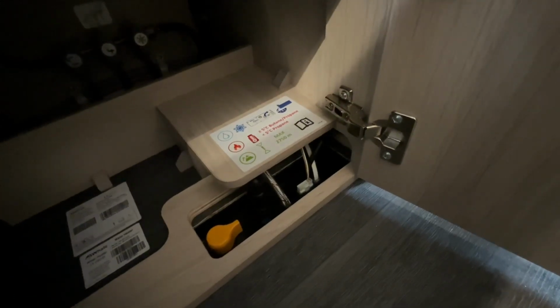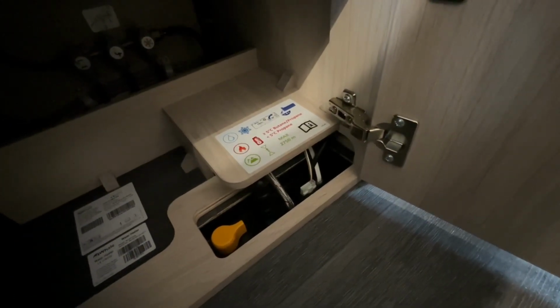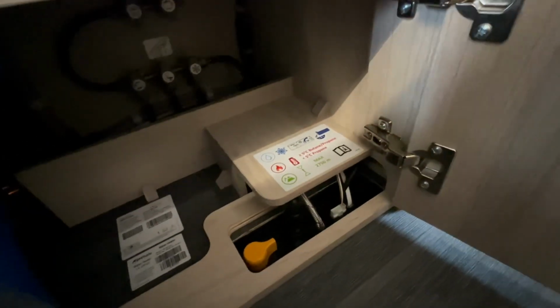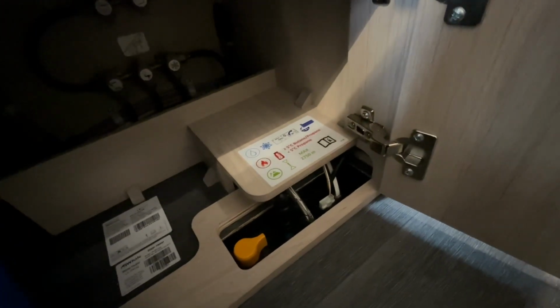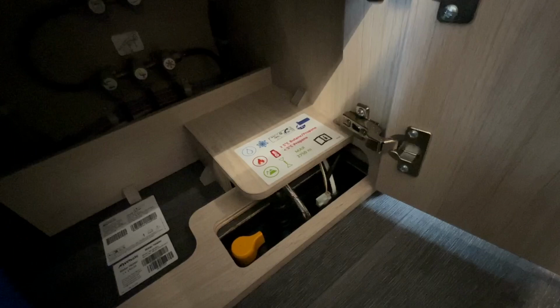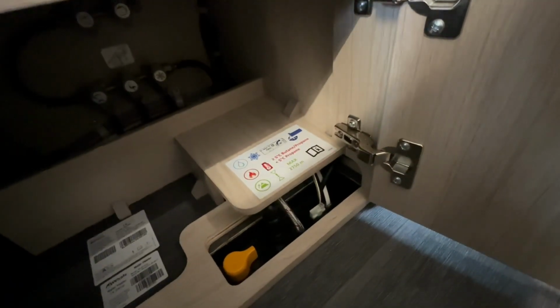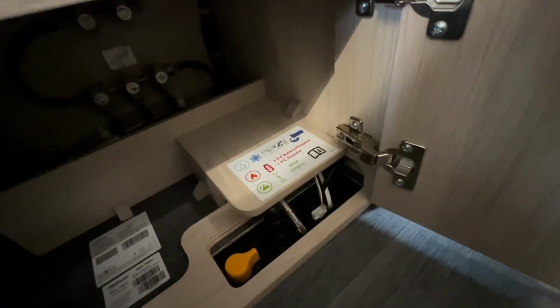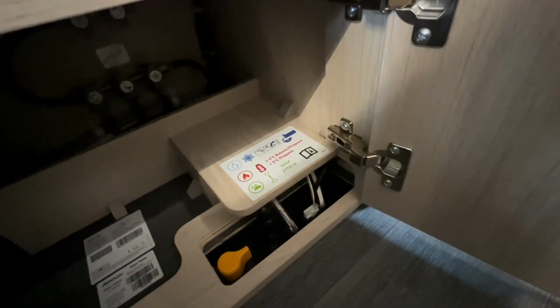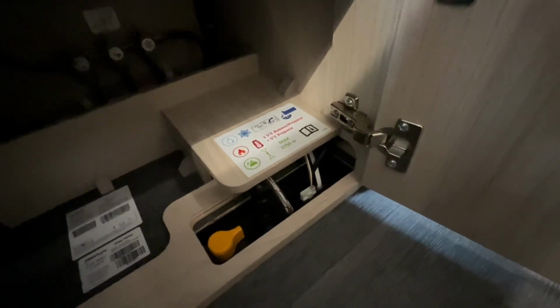When you come to reuse it, back towards the cab in that position there, shut the taps, shut the fresh and the waste, fill the vehicle with water, cold water from outside, which will be over here, comes in here in the tank, pump on, cold side open on the tap, slowly go around the hot. You'll get a lot of air compressed out the tap until you get a free flow of water from the hot side. This is when you know that your boiler has reached maximum capacity of 10 litres in the boiler.